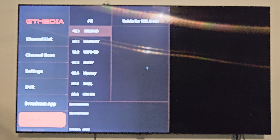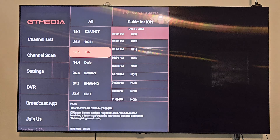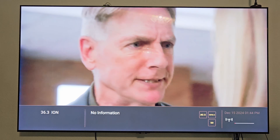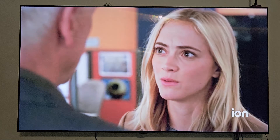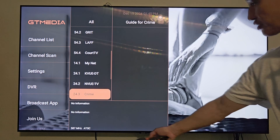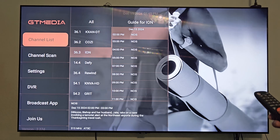The HDTV player gets you back to your TV channels. I've got a really bad signal from the small digital antenna, so let me try my other one. The other antenna picked up 18 channels. The signal strength is still pretty poor — that's down to the antenna. The better the antenna and the higher it's mounted, the better your signal will be. My antenna is basically laying on the floor since I have nowhere to mount it. All channels are showing as ATSC 1.0, not 3.0, so I can't test the broadcast app.